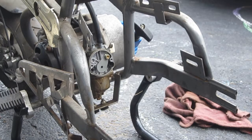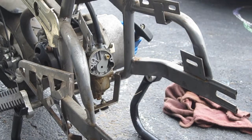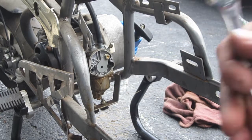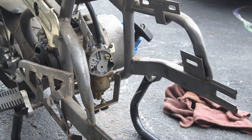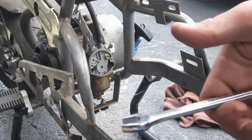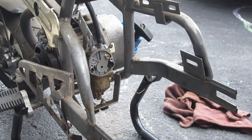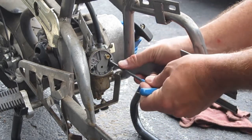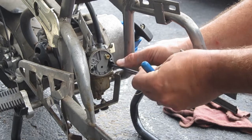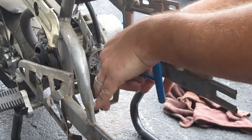This is pretty basic and straightforward. If you don't have your rear wheel in, you can do it through the top, but even then it's best to pull the exhaust off. The exhaust route is technically easier, but then you have a gasket you might have to replace. You need a 4 millimeter after you get the air filter off — mine wasn't even on — which is usually just two Phillips screws.